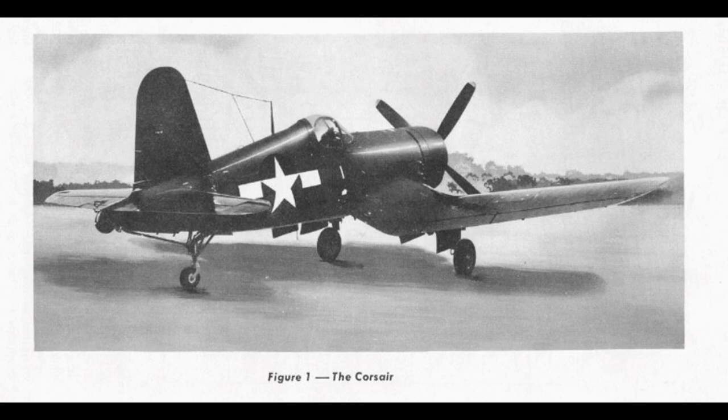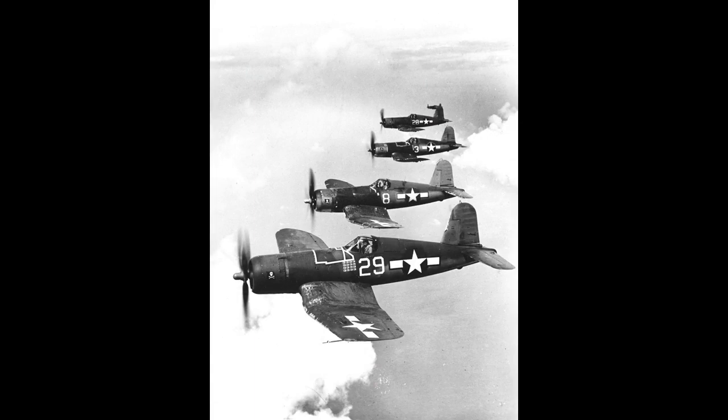The vertical stabilizer via the rudder puts a large asymmetric twisting load onto the fuselage. Thus, the vertical stabilizer has to be very solidly attached. The Corsair's fuselage tapers down a lot at the rear, and there isn't as much metal to attach to the farther back you go. Add to that the fact that the space back there is already taken up and the structure is compromised to some extent by the retractable tail wheel and arrestor hook. I just don't think they had enough solid structure back there for the vertical stabilizer.